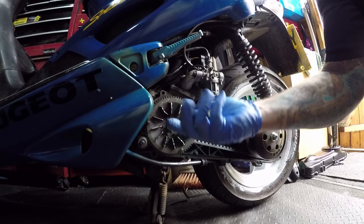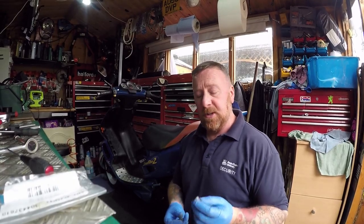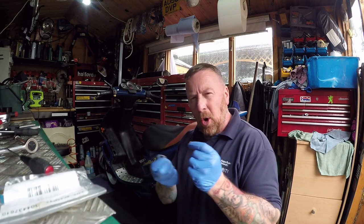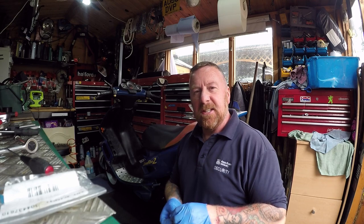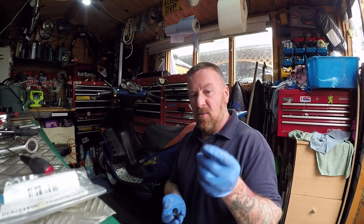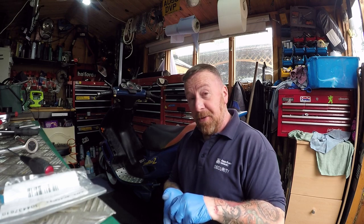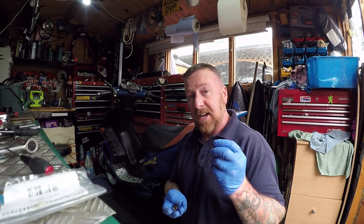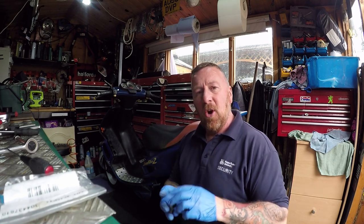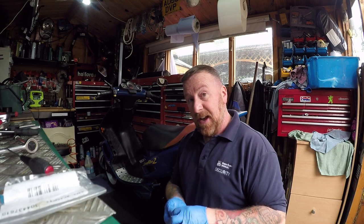Now, if you watch my other videos, I used to combi them, so I'd put like 8 or 9 grams with 3 or 4 grams, but I found all round 6 grams, 36 grams in total for your variator was good. I reckon these are about, oh, these are heavy, about 9. So I might put 3 of these in after I've tuned the carburetor and 3 of the others in, but if they're not rolling right, then I'll put them in, combi them. So let's have a look how this goes.